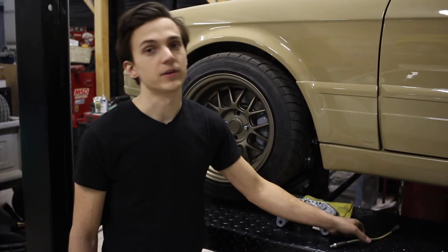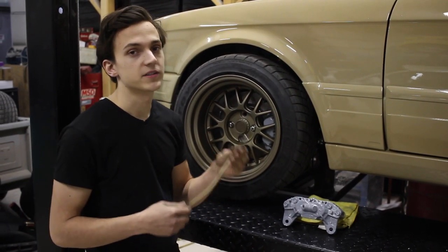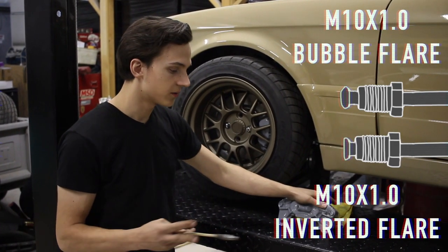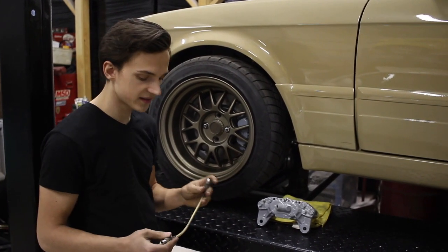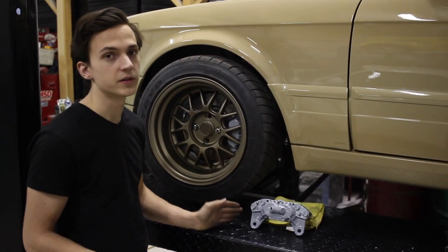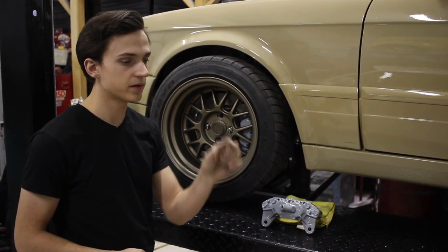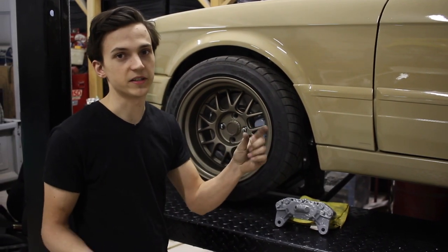Now it's time to hook up our calipers to our brake lines. The biggest thing is that on your BMW, all of the brake lines are M10x1 bubble flare, whereas on the calipers it's M10x1 inverted flare. So there are a couple of options. You can go online and get all the necessary adapter fittings to make it work with your pre-existing lines. The second option is a little bit cheaper — go to your local parts store, buy a length of M10x1 bubble flare line, cut it really short, put an inverted flare on the other end, and it works great as just a cheap little adapter.